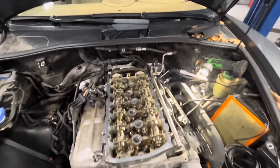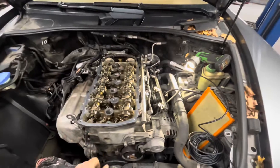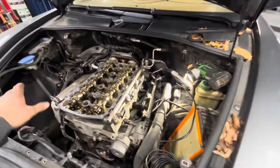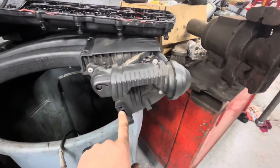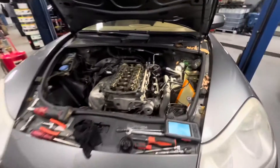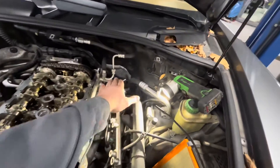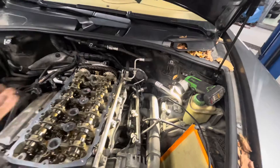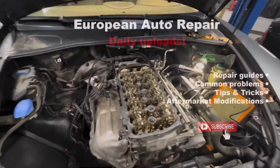Other than that, I don't love this valve cover job either, because it has a one-piece intake manifold that wraps all the way over the top of the valve cover. Right here — it's a one-piece deal that goes all the way across. You have to pull the high-pressure fuel rail off the bottom and everything, so it's actually kind of a pain. Some of the other ones have a two-piece design where you can just remove the upper intake, which is a lot nicer. But that's not the case on this one. Anyway, thanks for watching.